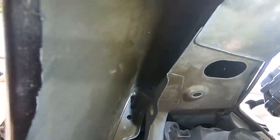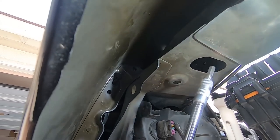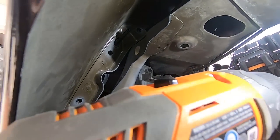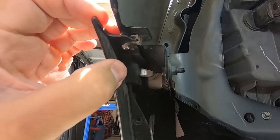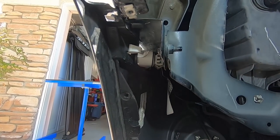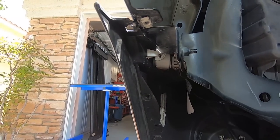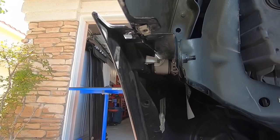I'll highlight that upper bolt up here — it's a little hard to get to. I use a flex line to get to these because it does make it easier, but that bolt was too tight for it. I was able to extend my bit a little bit and get up in there with a small drill, and it came right out. So we got the 7 millimeter bolt out. You'll see there is some wiring we're going to have to end up disconnecting — I believe the harness is on the passenger side on these ones. Rinse and repeat on the other side and I'll show you which harnesses to disconnect.